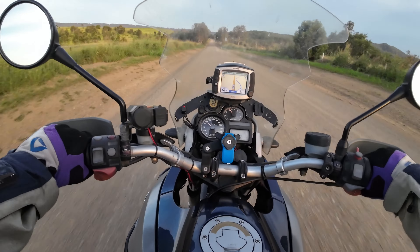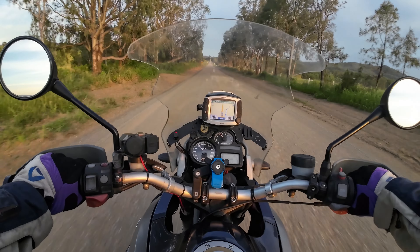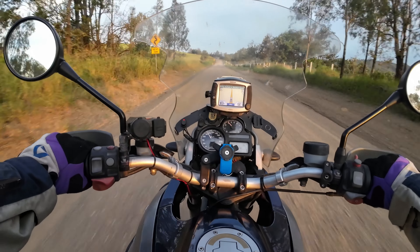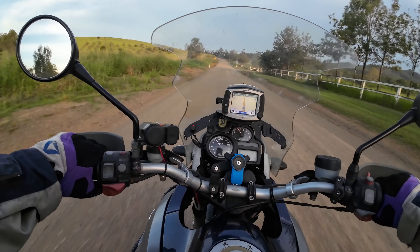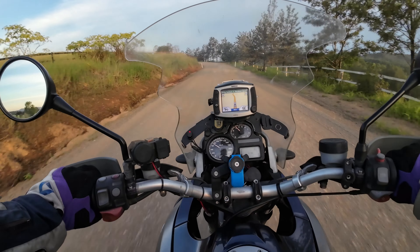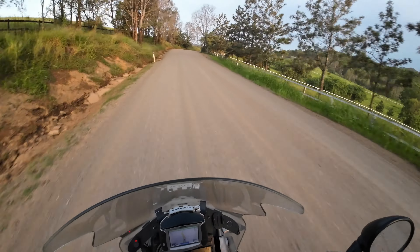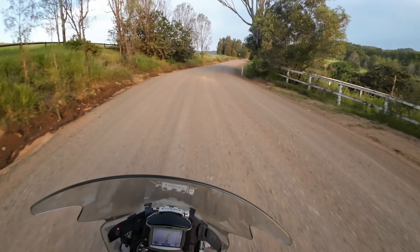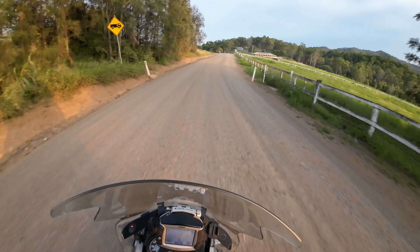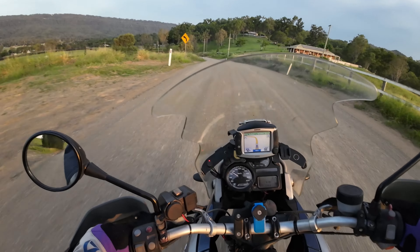Let's give it a burst - there you go, look at that, won't spin the back up. Traction control - it's a pain in the ass. You can get up to speed alright, it's just overtaking or when you want to give it a fistful it just won't let you have it. So it's either starving for fuel a bit - but it's not missing, which makes me wonder whether it actually is the coils. It's not running rough otherwise - it'll accelerate under smooth throttle response until you get to that point where it just says no more.